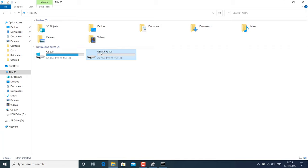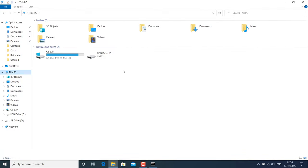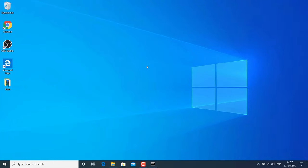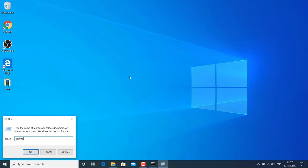If your SD card is being detected on a Windows PC, these steps should help you repair it. There may be a different situation after inserting your card — you might get an icon without any information about your SD card. If you are getting this kind of icon, that means you have unallocated space on your SD card, so you won't be able to use it or copy/paste any data. Press Windows + R and type diskmgmt.msc to open Disk Management.